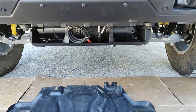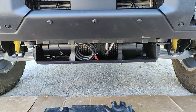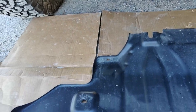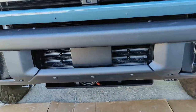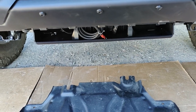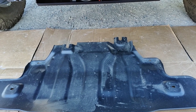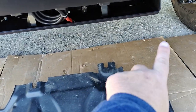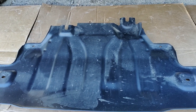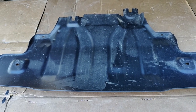As you can see, we have the winch plate — the mounting bracket — in place with the winch installed. We call that the winch tray. You can see on the left and also on the right the bolt locations for the factory skid plate that comes with the modular bumper. The bottom two holes slide in, which gives a little bit of adjustment. I've already fitted this up and it looks pretty good — no real modification is going to be necessary. Interestingly, the support of this tray is going to strengthen the skid plate and provide another point of support beyond just the two holes.